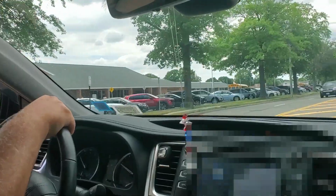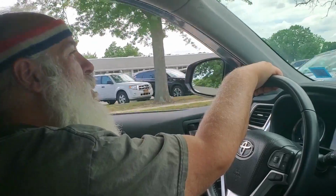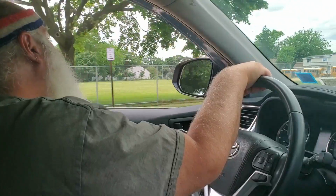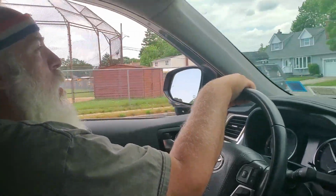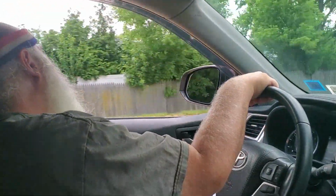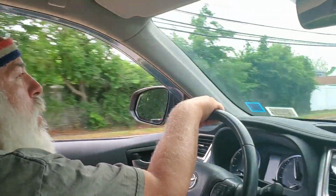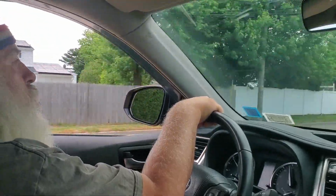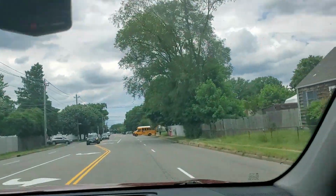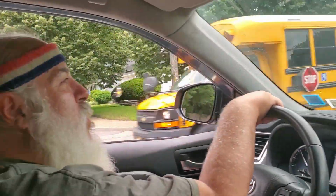Jay's driving it. I drove it. Yeah, this is my first time driving it. It's trucky. I've never driven this before. So we determined that the pads and the rotors on the passenger side are potentially okay. I could definitely feel a shimmy, a little something in there. And then we determined that on the driver's side, front is okay, and there's a little groove on the inside of the driver's side. And now the bus, oh, we're gonna stop. There you go. Right, I've recorded you.